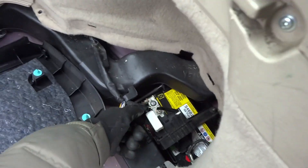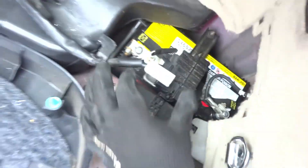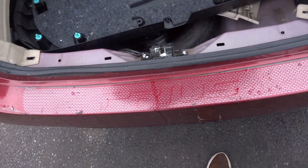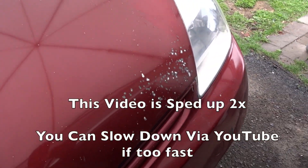You're going to want to disconnect the negative battery terminal as well. Disconnect this terminal from the battery — this is the positive, actually. You could disconnect the negative, but it's a little harder to do. So you just reach under there, there's a little tab, pull that up, leave this open. You can put a rag right there and close this so that it won't latch, otherwise you're going to have to climb in through the front. This is also not going to be like a full-on beginner video — it's going to be more of a faster video, assuming you know how to do basic mechanic stuff.